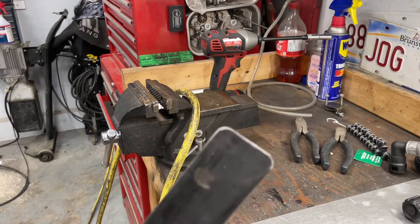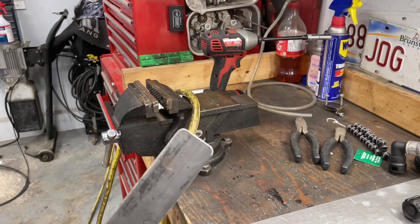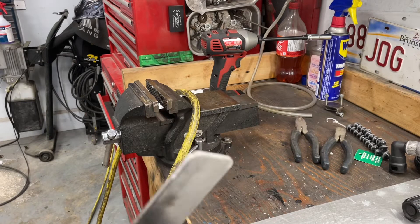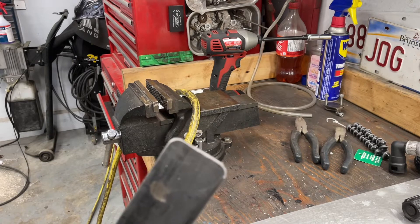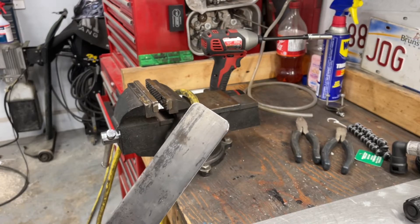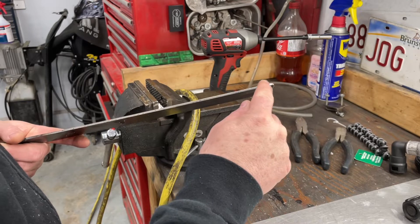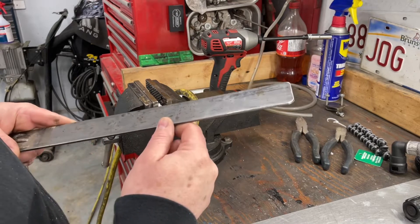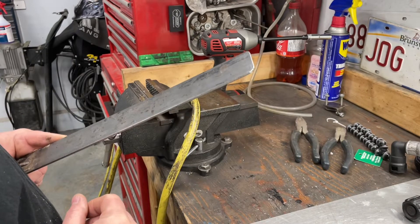I just got this piece of flat bar here — inch and a half or something like that. First thing I did was round off the corners. You should always do that, just to keep from possibly having a sharp point rub through and make a hole, and it saves jabbing your hand too. The next thing is I think I'm going to have to put some kind of little bend in it. You can do this right in the vise. I'm just going to go size it up on the car and see what I think I need and go from there.